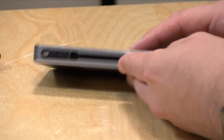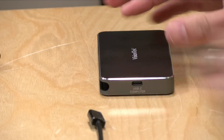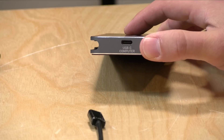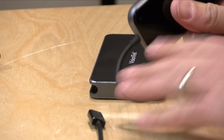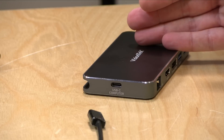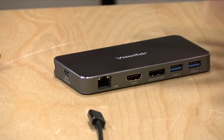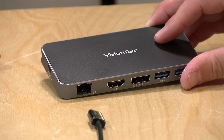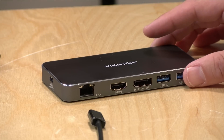What I really like about this dock is that it has a built-in cable, but it's optional — it garages itself very securely in a holder on the back. You plug it into the port that connects to your computer, but if you want a longer cable you have that option. So many hubs I've looked at have pre-attached cables that are difficult to travel with because you worry about snagging the cord. Here the cable can be removed and stored, so it travels better. And if you're using this as a desktop dock, you can get a longer USB-C cable and position the dock where you want. Just know you'll need a USB Type-C cable that supports 100 watts of power delivery and DisplayPort alt mode to get all the displays working properly.